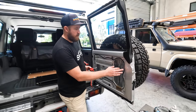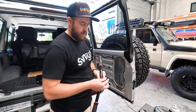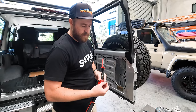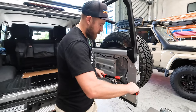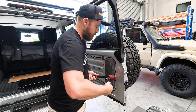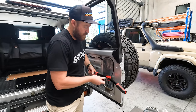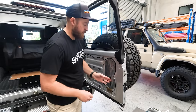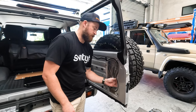Once the paint has dried and you've covered up all the raw bits of metal, you can fit your nutserts. How the nutsert gun works is you just screw the nutsert onto it like that. You do have to set the height adjustment, so be careful on the first couple — you don't want to damage the threads inside the nutsert. Put it in a little bit, push it in snugly, and then push until you feel it's tight, then back out. Remove the nutsert gun — the nutsert shouldn't spin when you do that. If it does, go back and tighten it. That's nice and tight in there.